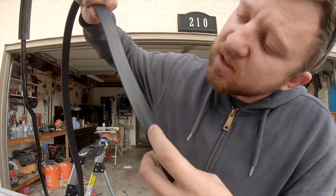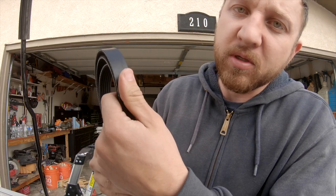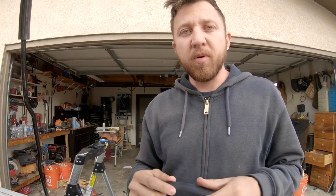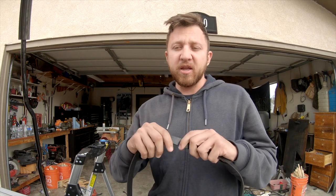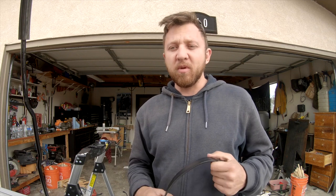So I turned it off and took a look. This belt is completely smooth — and compare that to a new belt, which has some grip to it. I also noticed where the belt goes around the water pump pulley, it looked glazed. Now I have a heavy-duty clutch on the Jeep, so what I'm thinking is that at higher RPM the clutch holds stronger, putting more strain on the belt. The glazed pulley won't get enough grip, and the noise has been getting increasingly worse — it used to happen at 3000 RPM, now it's down to 2200 RPM.